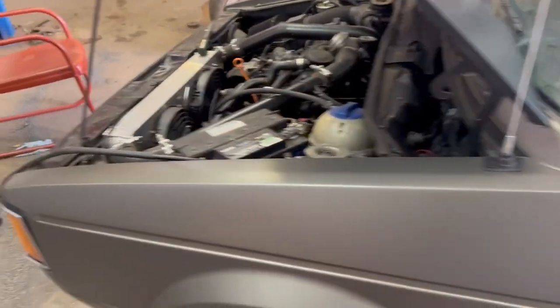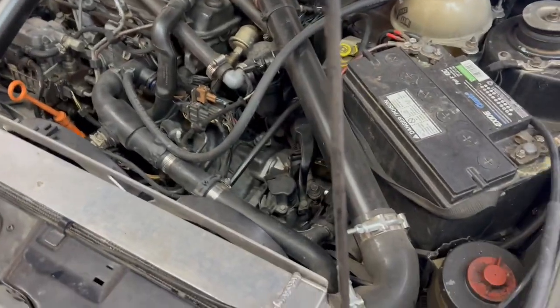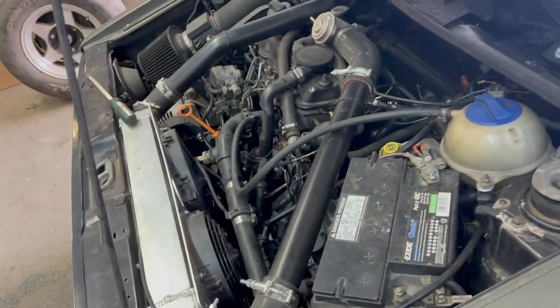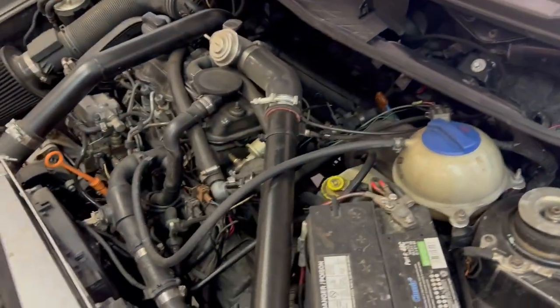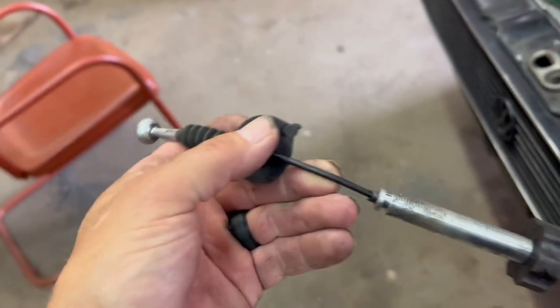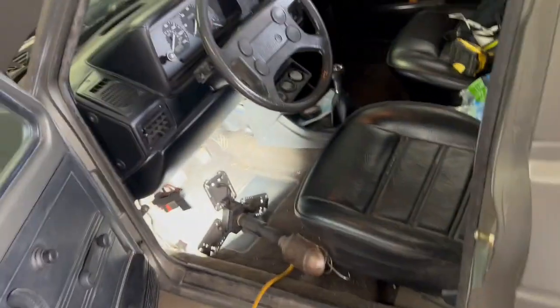Let's start working on my little rabbit truck. I've had the cable clutch in there since I did the 1.9 swap, and it has just been hard as everything to push lately. I had two regular cables break, and then S&P sent me this one with the nylon coating on it. There's something that's not aligned on the pedal — I don't know what it is.